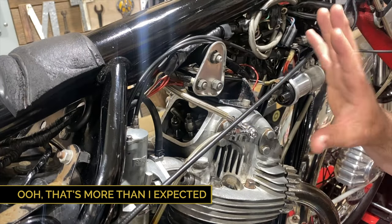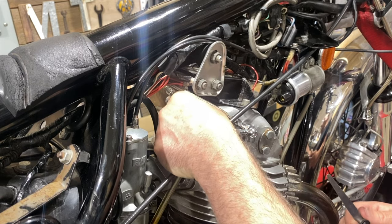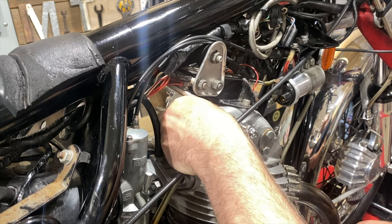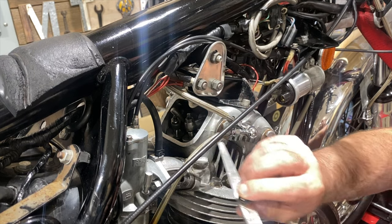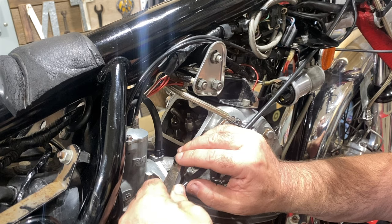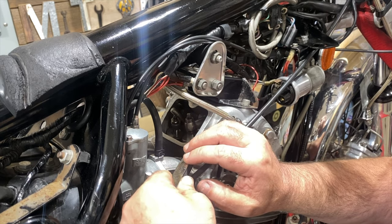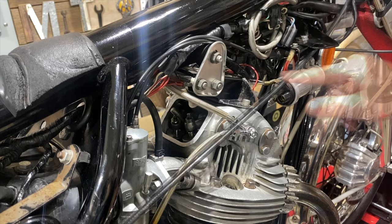It's no wonder that the bike's been a little tappity. Here on the inlet side, I've just measured this — it should be six thousandths on the inlet valve clearance and it's actually 20. So there's a feeler gauge for 20 thousandths of an inch, and that's going in — it's a little tight fit but it goes in nevertheless. I'll tighten this down, check the other one, and then move over to the exhaust side.